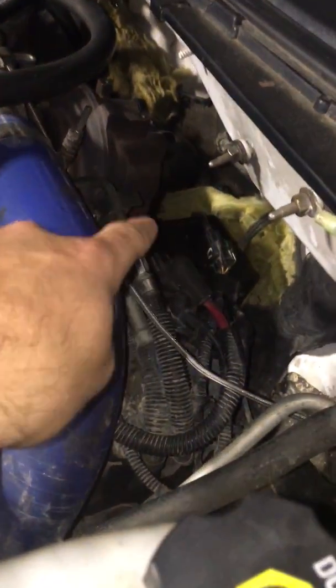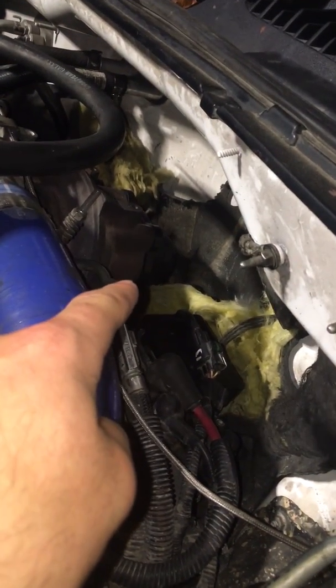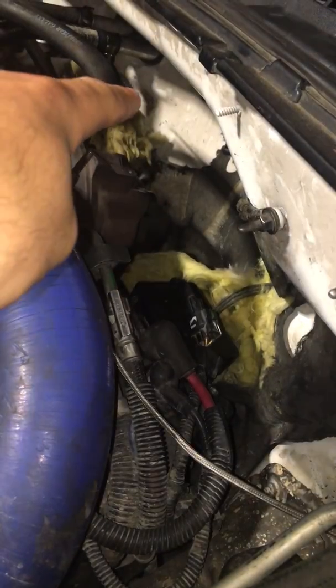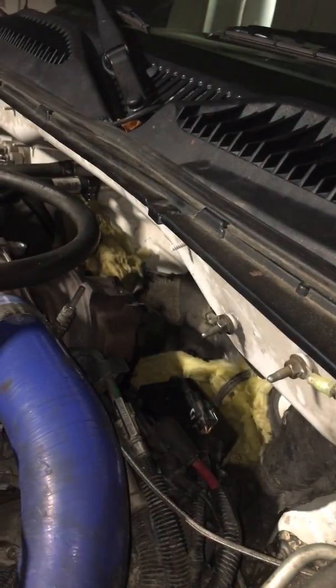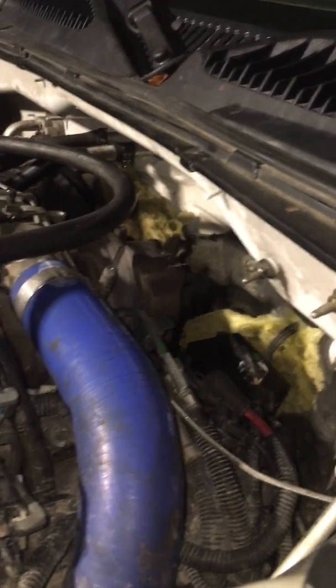And then the 6th one, down underneath. I tore a ton of insulation out, so just be careful. I've got to figure something out, I don't like it being all loose like that. But for that 6th bolt, we got a ratchet with a little extension so it cleared the downpipe. The ratchet was sitting between the downpipe and the firewall. I had the ratchet going out that way so that I could lay across the motor and pull it. I yanked all I could on it with my right hand. You just gotta have a He-Man, Thor, Hulk moment and put everything into it and you'll break it. Got my hand pretty good.